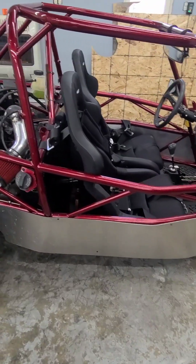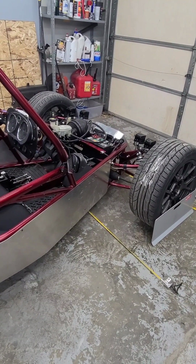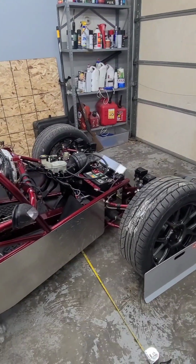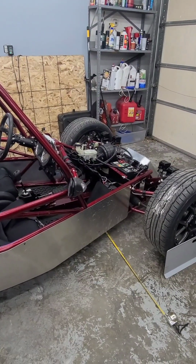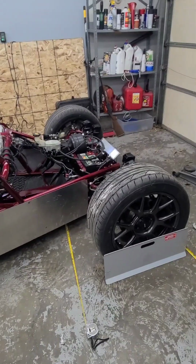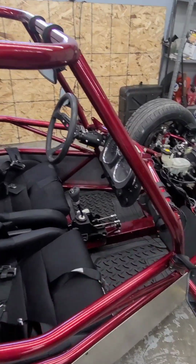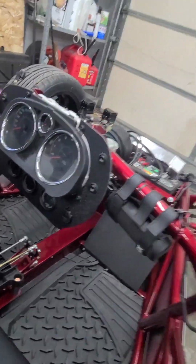So anyway, I'm going to work through this, and hopefully here soon I'll be able to mash the throttle and really get up and go. I have a guy here locally that I'm in talks with about dynoing and getting it up on the dyno and removing the top speed. I think this governs at 110. I'm not going to be hitting that, but then change the rev limiter to 7,200 RPMs, as well as adjust some fuel air ratio mixtures. I do have some check engine lights, but they're to be expected without the evap system, and I'm running an AFR gauge on that far right side there.